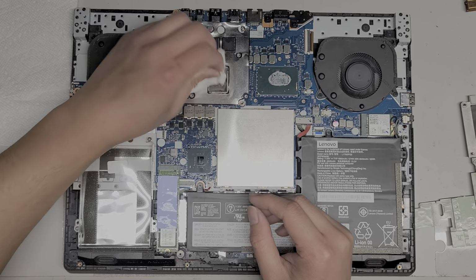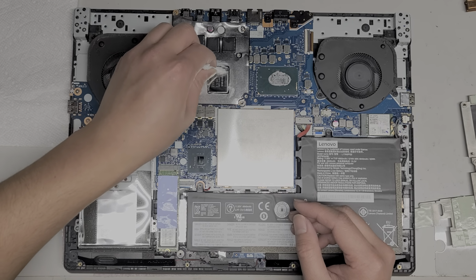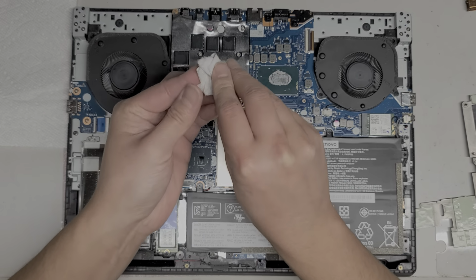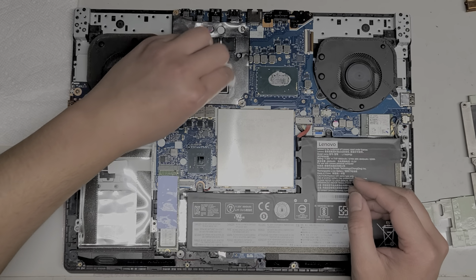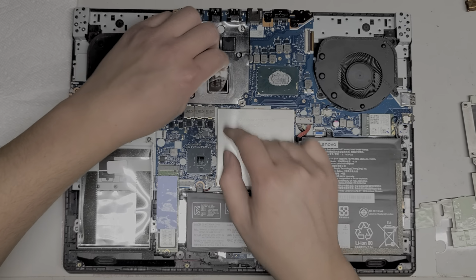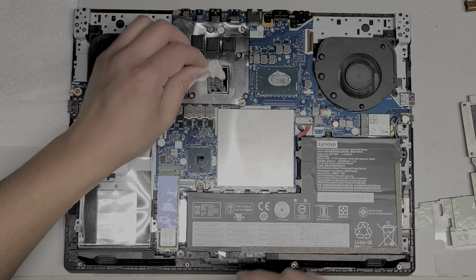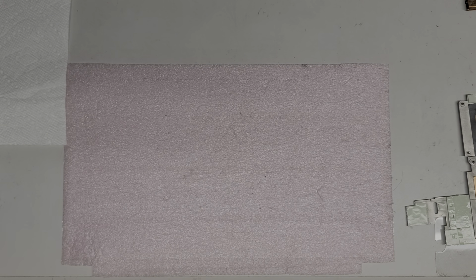So if the paste isn't too bad, it'll clean off actually really easily. Over time, if it overheats, the paste will actually become really difficult to clean off. So keep that in mind. If the thing overheats, it can dry up the paste and turn it into like a rock. All right. So you don't need to make it completely clean because the main thing is the heat will come off from the center, the top part. Okay. I'm going to have to flip this upside down before I start dropping the paste onto stuff. So I like to hold it upside down over a trash can while I wipe it usually. But then I can't show that in the recording. So hopefully you guys get the idea.